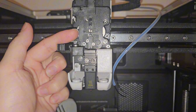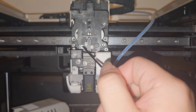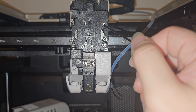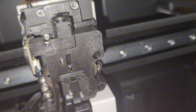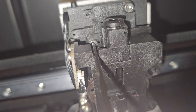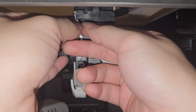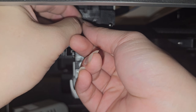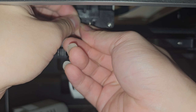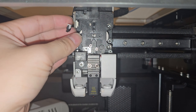I'm going to show you how to take off the extruder right here. First of all, we need to take off four screws — one screw back there, one screw inside here, one screw right here. If we look at it from the front, it's this one right here. They made a cutout for us, which is convenient. But before we take off any screw and take off the extruder, I highly suggest taking off the wire here first, because this is a short wire and if you accidentally pull this, you might break it.